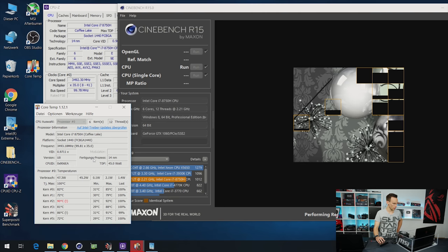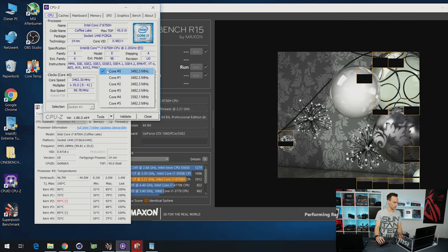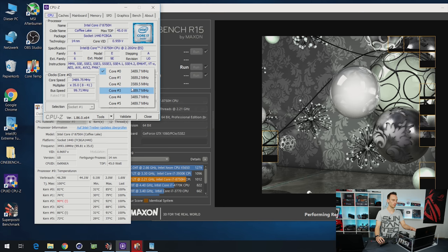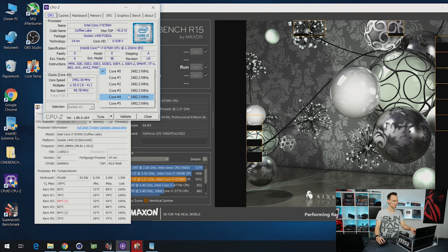Oh yeah, you can see it boosts like 3.4, 3.5. That's a solid improvement now. By the way, I tried that before without Novec, undervolting, and it helped like 100 or 200 megahertz. So we went up to 3 gigahertz boost max on all cores. And with Novec now, 500 megahertz improvement, not even mad.